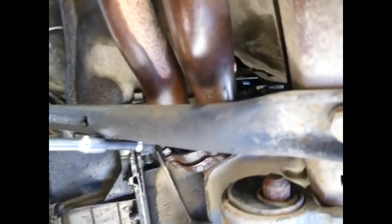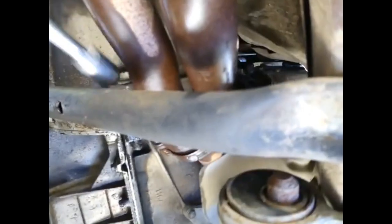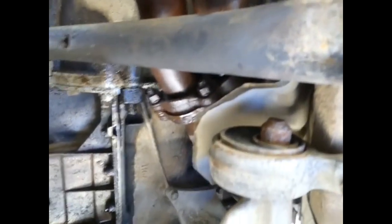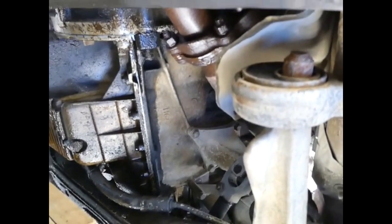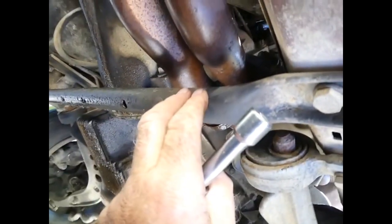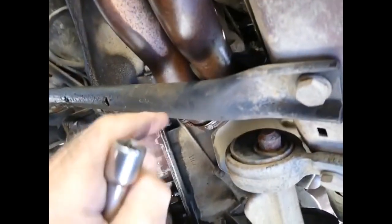Those are 15mm nuts, and I have previously squirted them with CRC. You need a long socket to get on the wall. Yeah, I can get a straight line to the wall. Well done, BMW, for that. I won't take this off yet, though, that's the next item, as when these are off, this will conveniently drop down, bonk, and rest on there while I do the rest.